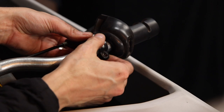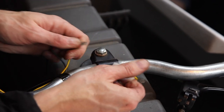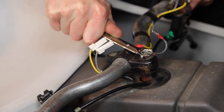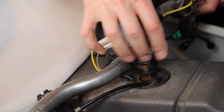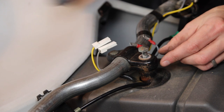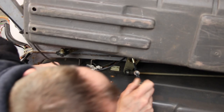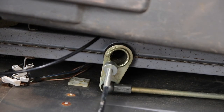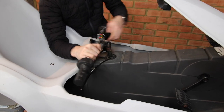Do the same on the right side. Disconnect the power switch by pulling the connectors apart. Remove the long bolt in the centre of the steering bar. The advice is to use the bolt to bash out the nut underneath, but I didn't have much success, so I removed the bolt then turned the machine onto its side. By reattaching the bolt from the underside and giving it a waggle and a pull, it came free. Now you're free to work the steering bar loose and pull it upwards.